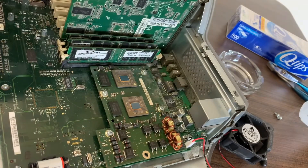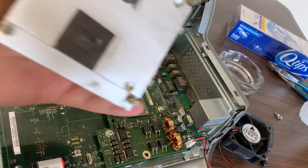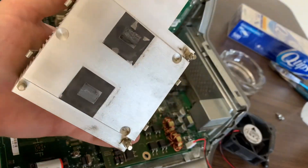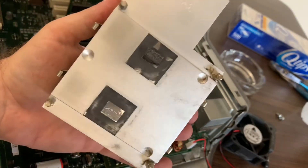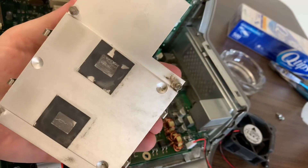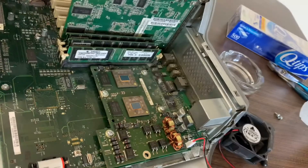There we go. And there's one other little piece of maintenance I did, by the way — right here where my screwdriver is. I had to replace the PRAM battery; fortunately it can still be found. So we can see there isn't a whole lot of thermal paste left on there — it's pretty lacking in thermal paste actually, and as hot as these CPUs get, that's sort of surprising.